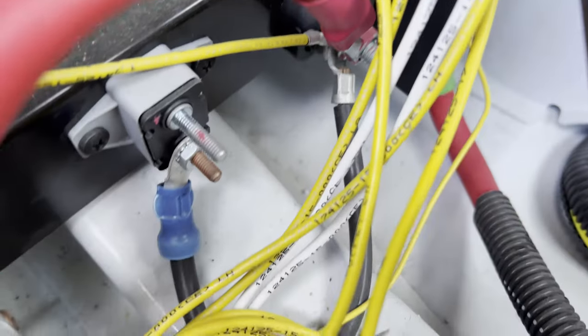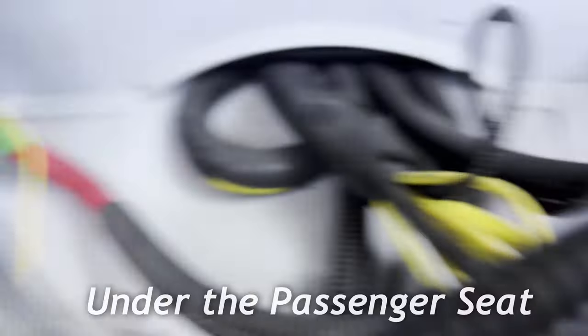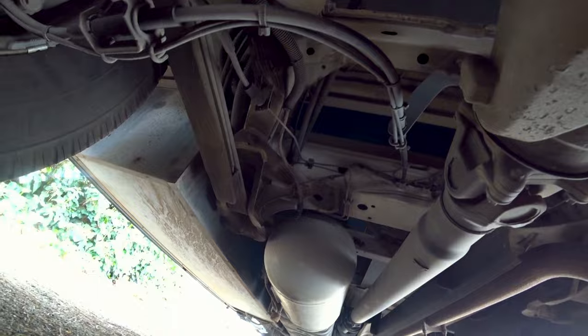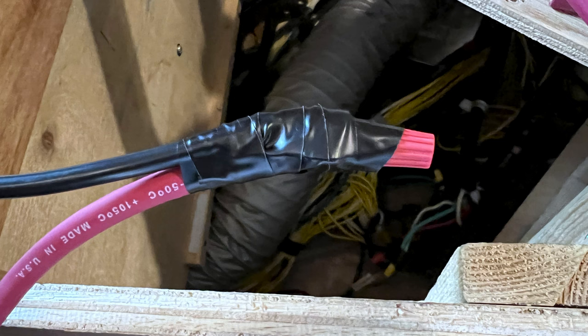The solar controller presented a little bit of a problem. That unit is attached directly to the 12 volt system. However, I wanted to charge the lithium batteries with solar, so I had to disconnect it and run a new wire to them. This is a very long wire that loops around underneath the chassis. I cut it off, splicing in my 6-gauge wire.